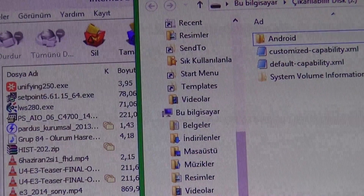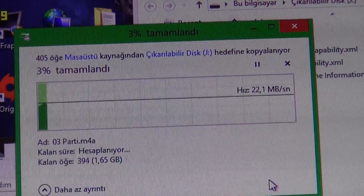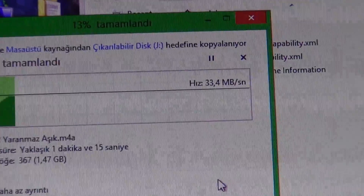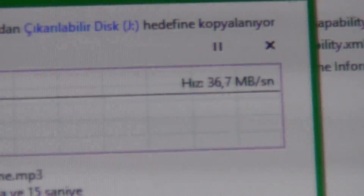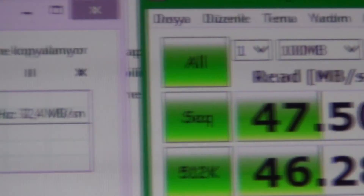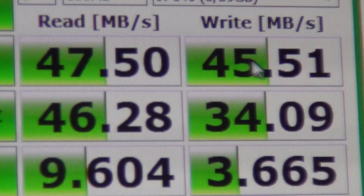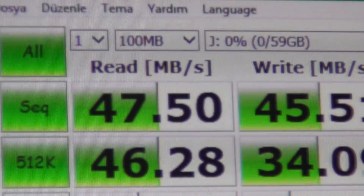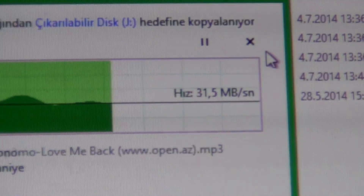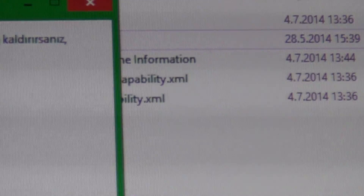Now let's try smaller files — let's try copying music files and see what speed we get. As we saw in the 4K test results in CrystalDiskMark, with many small files around 5 MB each, the write speed cannot reach its maximum. Small files at 512 KB don't achieve the same high write speeds as larger files. We're copying at approximately 33-34 MB/s. We can cancel that — no need to waste storage space.